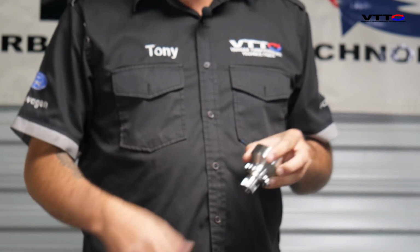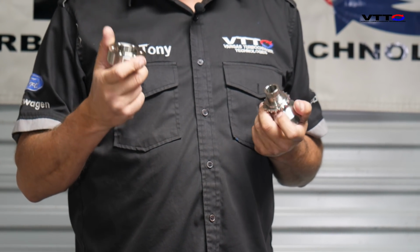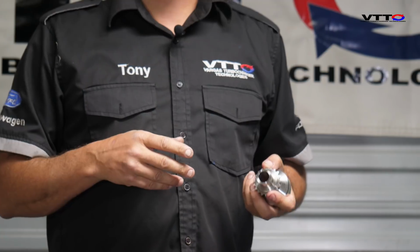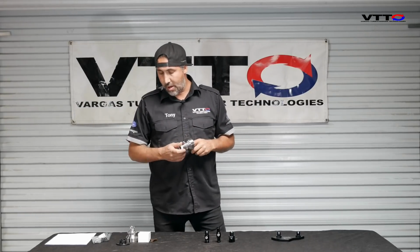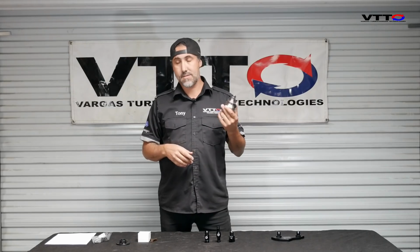Essentially, you guys know the crank hubs for the N54, N55, and S55 have an inherent problem where they will slip sometimes at stock power levels, and this could cause engine damage, bent valves, at the very least, a headache, a lot of labor to swap it out. Almost every issue that we've had with our shop cars, engine-wise, has been caused by this little thing right here. It's cost us many tens of thousands of dollars.